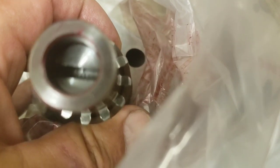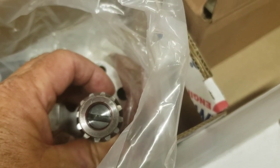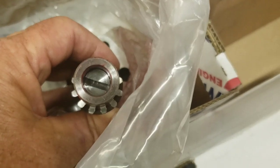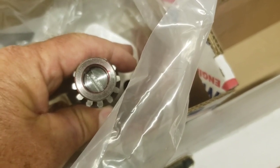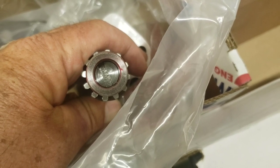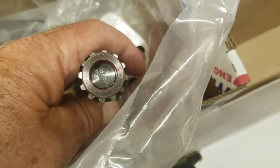The oil pump drives the distributor. And we've talked about distributor timing. See that fat section versus the thinner section? The fat half moon versus the thinner half moon? So we try to get that oriented to about 11 o'clock. That puts the rotor in the distributor hitting number one cylinder at 5 o'clock.